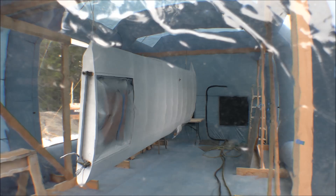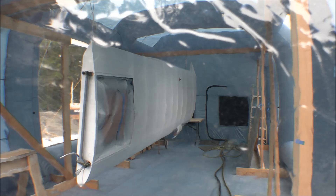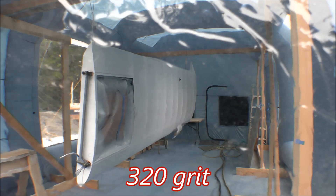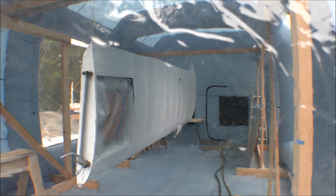So I've got a supplied air system - an air pump, a long line, and a hood that goes over my head, supplied with fresh air all the time while I'm painting. The problem is I'm looking through a plastic lens with it. Anyway, I got everything ready to paint. I came through here and cleaned out the paint booth the other day, blew it out, cleaned it up, and then took some 120-grit sandpaper and scuffed and sanded the wing. I just went in there and blew it out again.